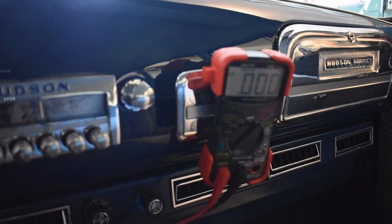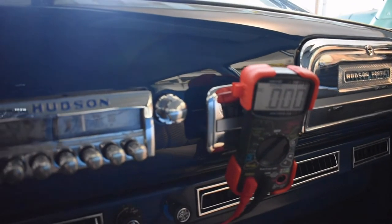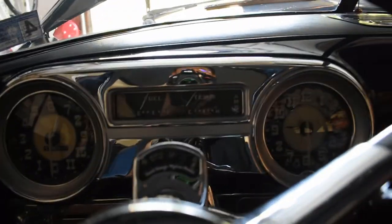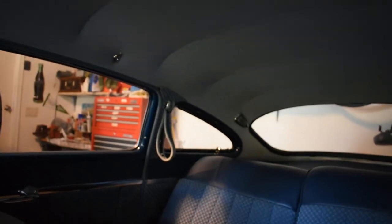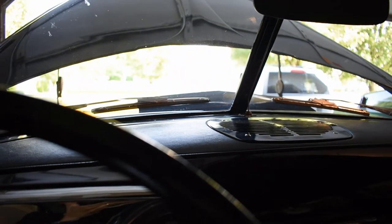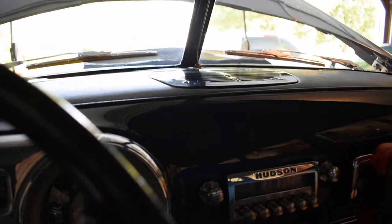What I've been dealing with is my brake lights popping fuses. I have courtesy lights — the map light, rear passenger courtesy lights, and all the door courtesy lights — and my stop lights, meaning brake pedal stop lights not tail lights, all on the same circuit sharing a power source. That's the fuse that was popping.